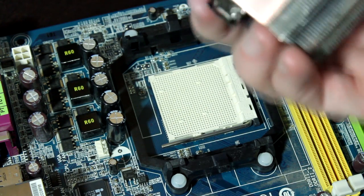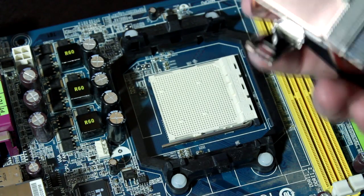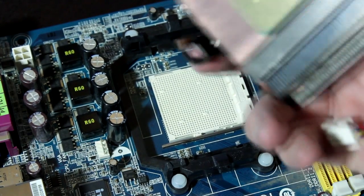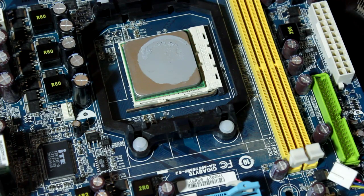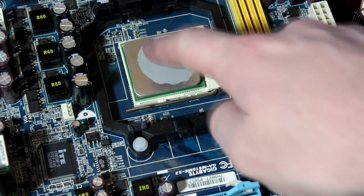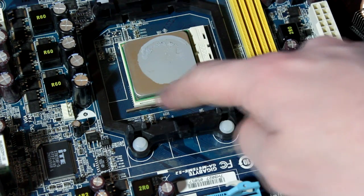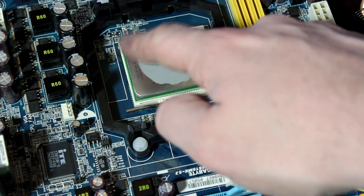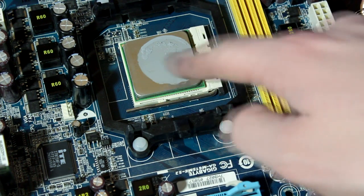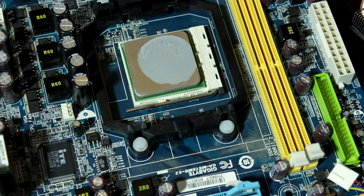As you can see, it's pretty adhesive — it actually took the CPU right out of the socket with it. Okay, we're going to go ahead and call that one a blooper. Now that we've got the heat sink off, this is one of the reasons why I'm not a fan of the P method. If you take a look at the edges, you can see that you do not have complete coverage of the heat sink on the CPU. This would have actually led to an overheating situation because part of the CPU would not have been cooled. It probably would not have caused any damage, but you would have noticed higher than desirable temperatures.